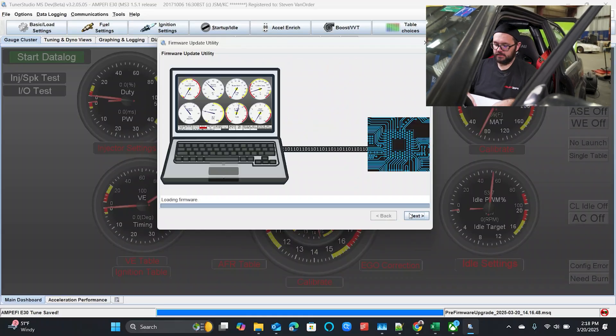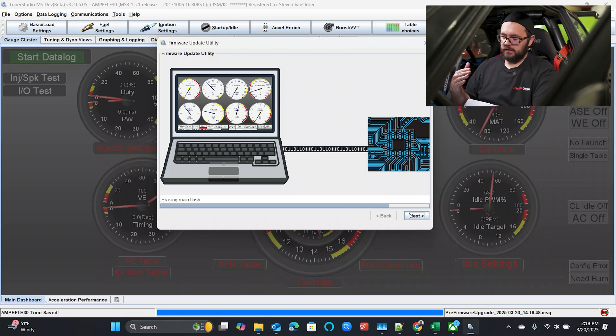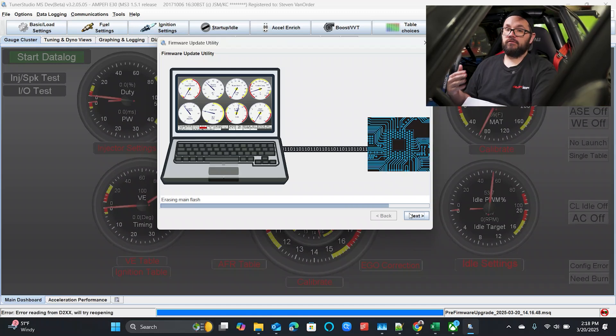You can see the first thing it does is say 'preserving sensor calibrations.' Loading firmware is never a fast thing — it's going to first erase the main flash. Very important: don't shut the car off. Do not disconnect from the ECU at any time. Also, before you start updating, if your car has been sitting for a while — maybe sits the entire winter in storage — put a battery charger on it first. The last thing you want is the battery to go dead during a firmware update, and the ECU will seem like a brick afterwards. If it's erased the main flash before loading anything new, the ECU will be blank. That's fixable — it's called bootloader mode. If that happens, just contact tech support and we can help you out.